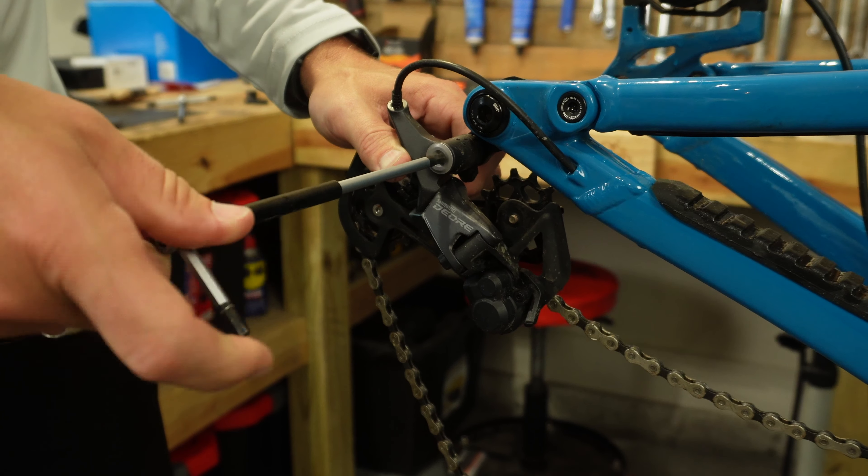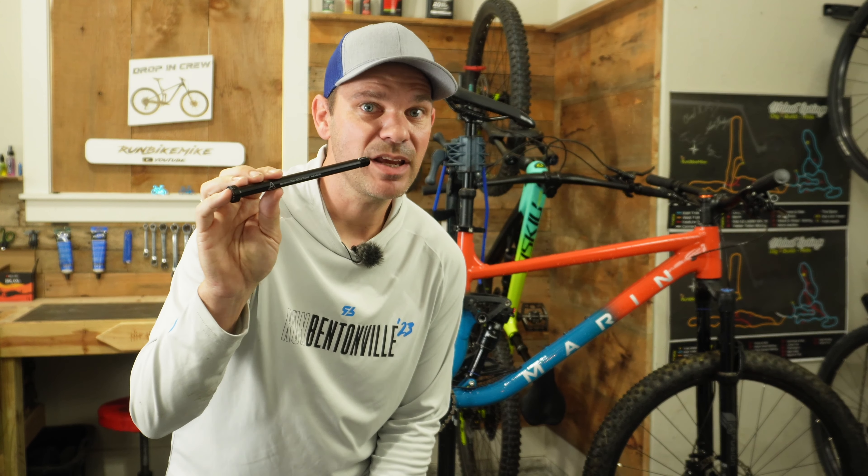Now for the most important and one of the trickier parts to find: the through axle. I purchased this from Wheels Manufacture for a little under $40. The specs you're going to specifically need are 12 millimeters by 174 millimeters, and the thread pitch has to be 1.0 — that's to make it compatible with the UDH derailleur hanger threads. This one has a 13 millimeter thread length, which should work perfect for the SRAM UDH hanger.